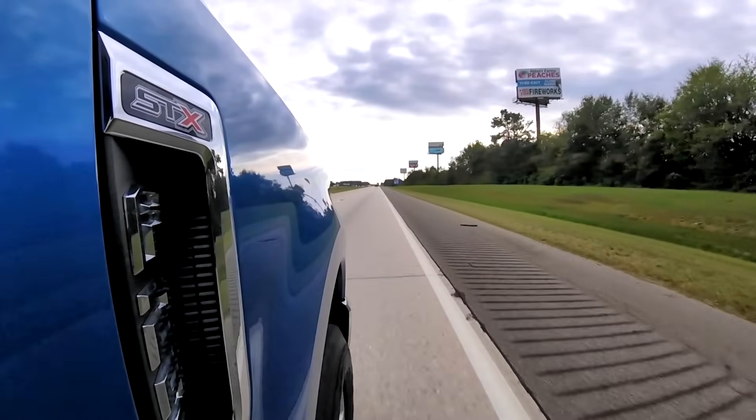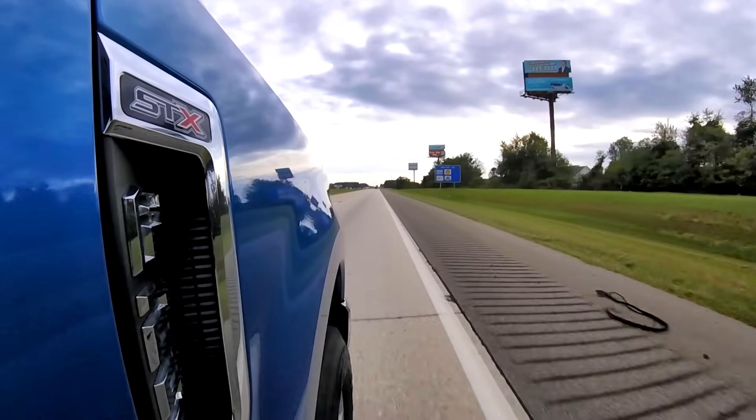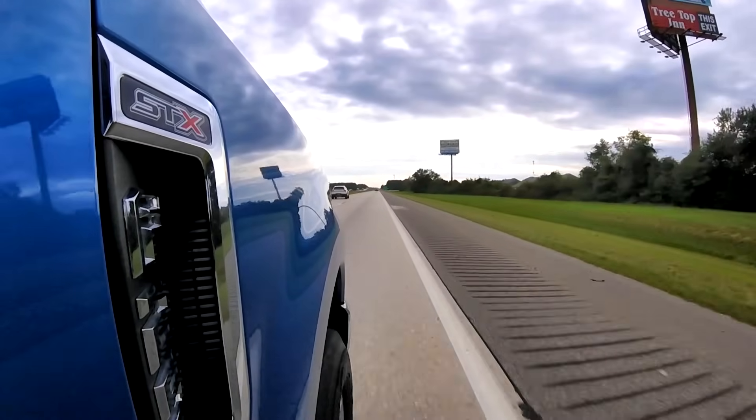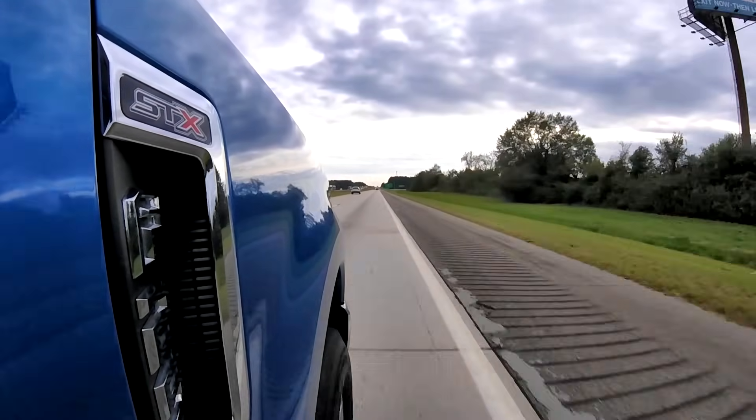You saw 20 horsepower and 20 torque basically all through the meaty part of the RPM range, and you'll definitely see even more so on the top end. What I like about the kit is that at 3,500 RPMs you're picking up 100 more pound-feet of torque — and that's huge. This is where that vehicle loves to be: 3,000 to 3,500 RPM towing. Say you're towing through the mountains or you're towing 12,000 pounds — it lives right there.